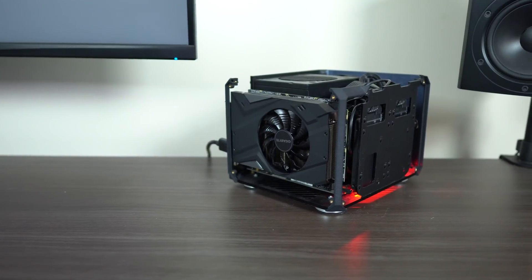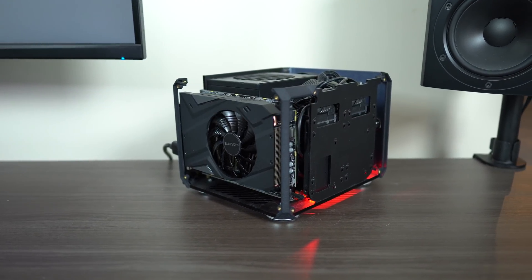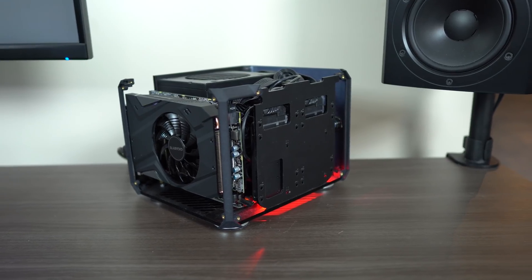With a 175-watt TDP — which is down 5 watts from last year's 1080 — you should be able to comfortably power this from most DC-DC power supplies or compact SFX or SFX-L power supplies. My test system consists of an i7-8700K clocked at 4.7 GHz, 32 gigs of Corsair Vengeance DDR4 RAM clocked at 3,000 MHz, and an SF450 SFX power supply, running all tests in a Lazer3D LZ7 with all panels off, which mimics an open-air test bench.